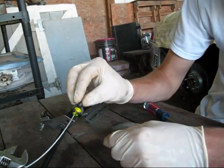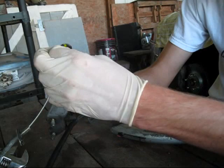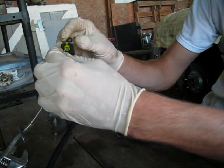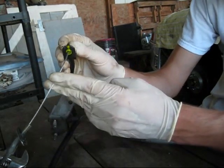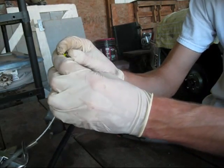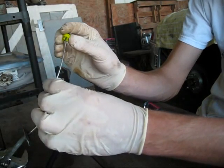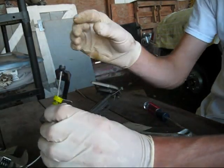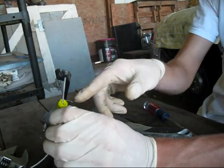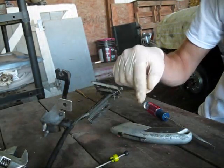Basically what you do is you pinch the back together and it'll push out and through. The key is you've got to make sure the wire's centered in that hole, otherwise it won't let you compress the 2 tabs together and get through the hole. Once you press, it pops out and the wire can come up and off. Then you'd have to lay under there and get this piece. We want this yellow piece, and the only way to get it is to cut it.